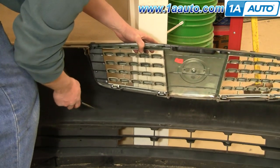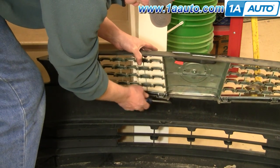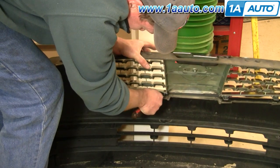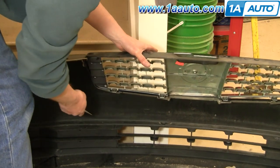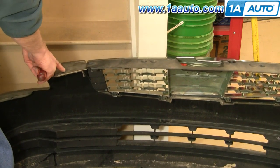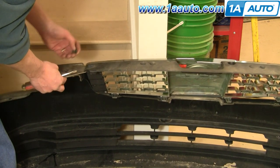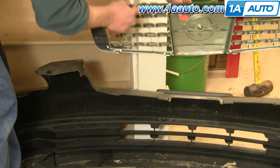This vehicle — somebody has just kind of ripped this off, or maybe it got damaged in an accident. You can see there are supposed to be little slots here where these tabs on the grille lock into. With the fascia off, you can easily get in here with a screwdriver, push on these tabs and unlock them. Over here there's a little plug — you push the middle of the plug down and that allows it to unlock. You would normally unlock each one of these tabs and pull the grille off.